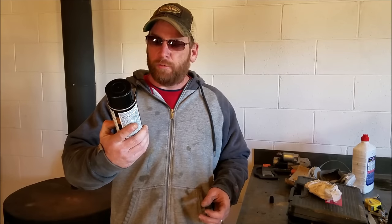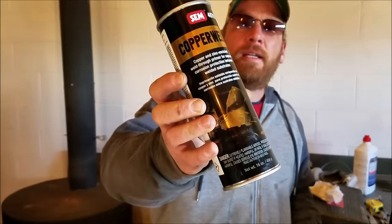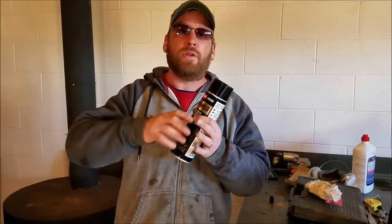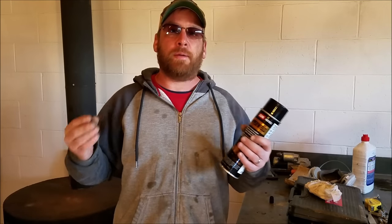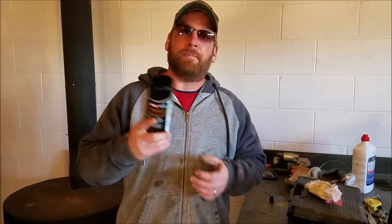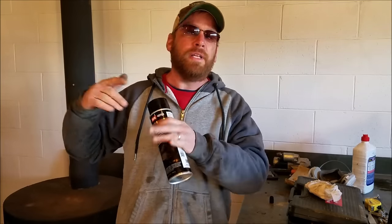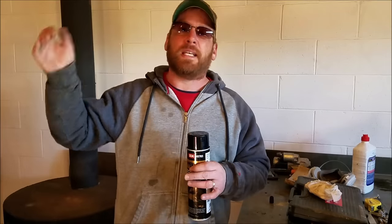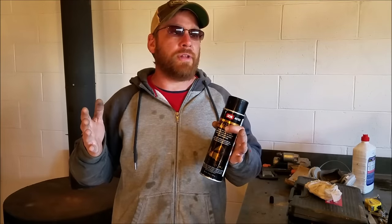Copper weld — it's copper and zinc enriched, so it's some kind of zinc primer. This is the kind of primer you get when you want to put two seams together. Before I welded that patch in, I should have sprayed this in between the two seams. You can still weld it up and it doesn't catch on fire and all that, and it protects that metal where the seams come together. But I'm going to spray this on the back side of that seam anyways, before I weld in that new fender weld piece on the inside, just to try and keep everything from rusting.